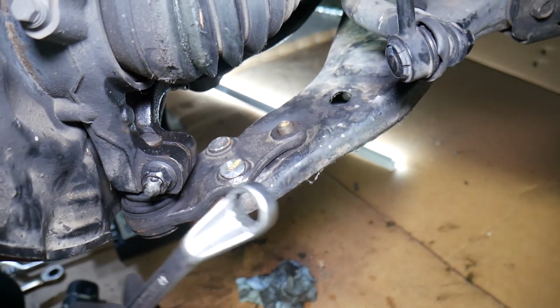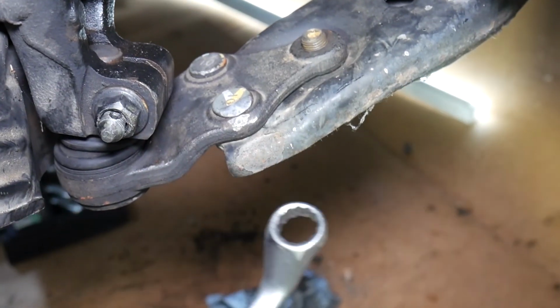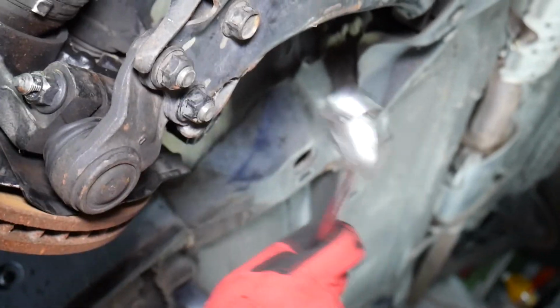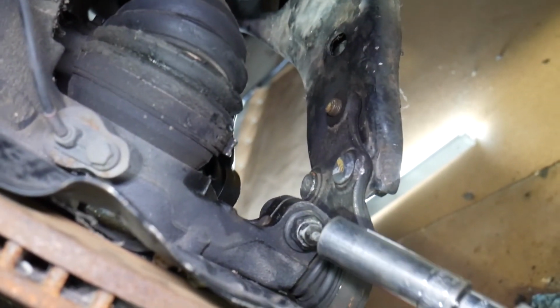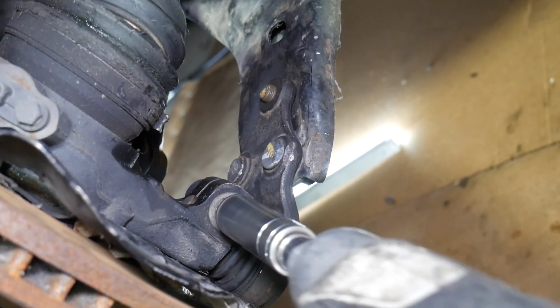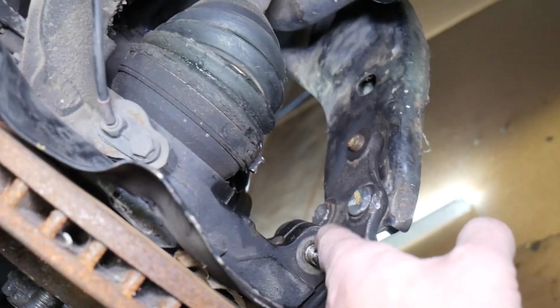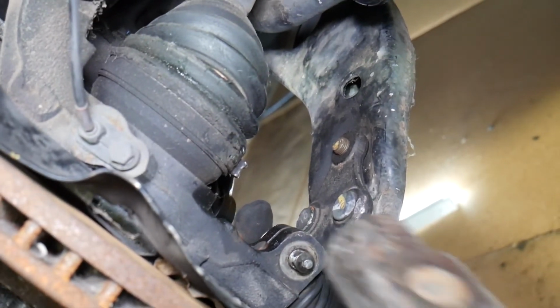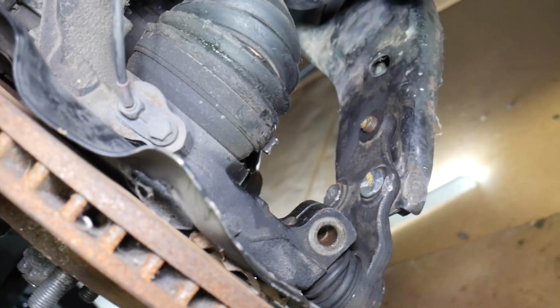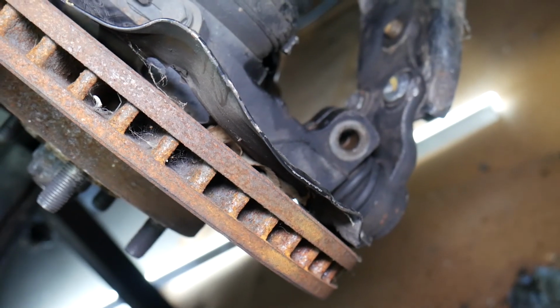Now let's explain. We need to go ahead and get it loose. With a 17mm socket, we pre-loosen those. On the bottom often you will have 3 bolts or nuts, or a combination of those. We have 2 nuts and a bolt. So what we'll recommend to do next, after everything is loose, you will need to hold the bolt on the back side with another wrench and get the nut loose. Perfect. Now, it's recommended to replace that bolt every single time. If it's a pointy bolt, you can hammer on it gently to pull it out. If it's a regular bolt, you can install the nut like 4 revolutions to where you can push it out, and then remove the nut and pull it all the way out.